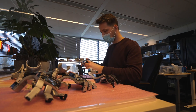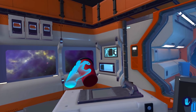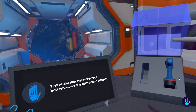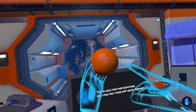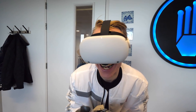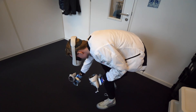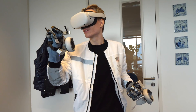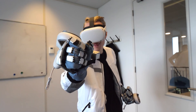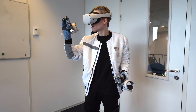So how do the Nova gloves actually work? They use magnetic brakes connected to a pulley holding two fishing wires that are attached to your fingers and fingertips. The moment it detects a collision in the VR environment, it triggers the brakes and stops your fingers from moving any further. The strings are incredibly strong — impossible to snap, trust me, I tried. The ability to simulate density, size, and shape is a true game changer, making you wish you could use them in games like Half-Life: Alyx or social apps like VRChat — but we're getting there.